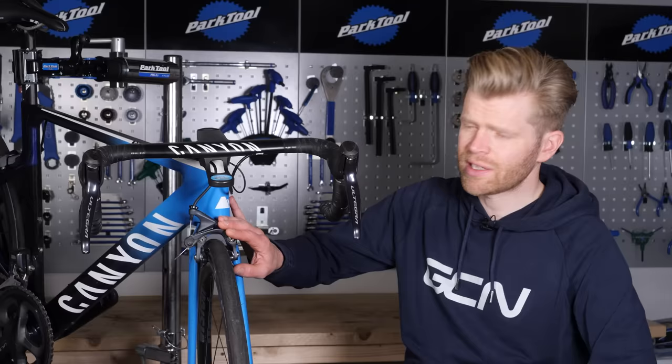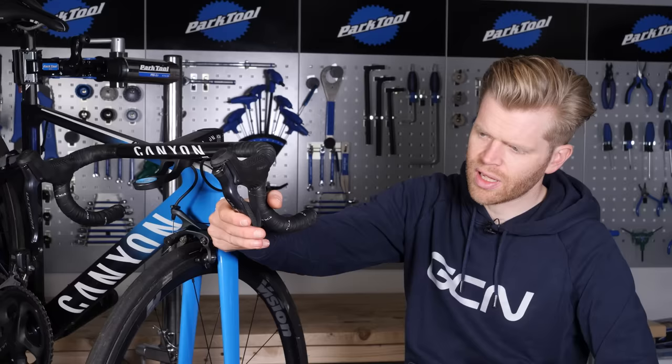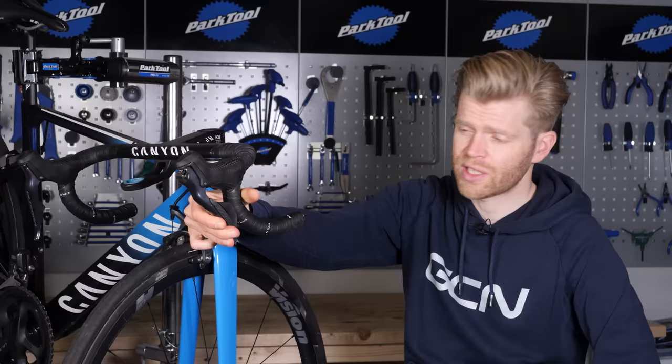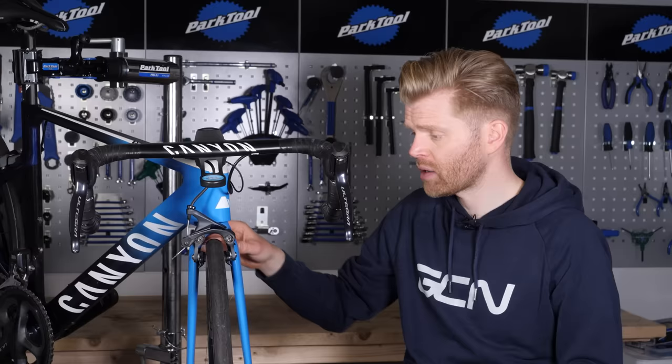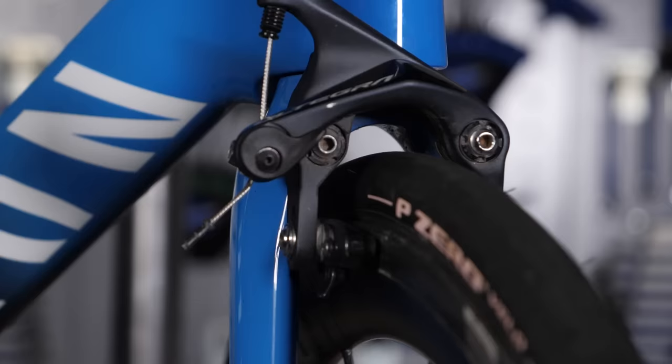Another thing to check is the distance of the brake pads to the wheel rim. Having them closer in will mean that when you pull the lever, your brakes come on sooner. I personally like to have them really close so that you only have to pull the brakes a bit and they start to come on, but it's personal preference. Some people like to have them quite slackened off. Bear in mind that if your wheels are rubbing, it might mean you've got a flexible wheel and being very close to the pads is causing it to flex and rub on the brake pad, particularly when you're out of the saddle or sprinting. If you're experiencing that, it might be worth running your brakes a little bit wider.